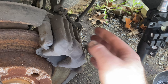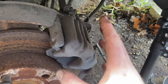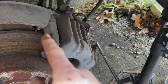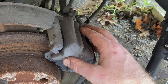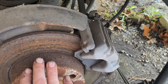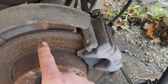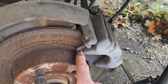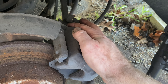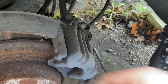First we're going to pull this up, and there's going to be a brace rail underneath. If you're just changing the pads, you only need to pull the caliper up, leave everything else on, and put the pads on. I don't advise doing that though — I advise getting your rotors cut or getting new rotors every time you do pads, because if the rotor has lines in it, it'll wear your pads out much faster. Let me show you my trick for getting the two bolts out.